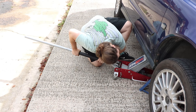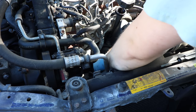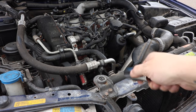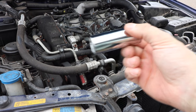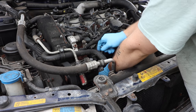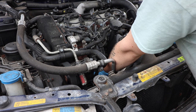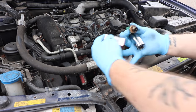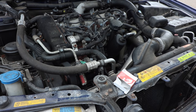I've already cracked the sump nut off and got the oil draining. As you'll see in a couple of seconds, I had to resort to interesting methods to get the oil filter out. I just had to nip out and go get a 22mm deep socket for the oil pressure sensor, because you can't really get a spanner on there because of the way it's located. So we've got this — let's get that out and then carry on. In these next couple of clips I'm just getting the oil pressure sensor out and replacing it with a new one. I'm comparing the parts to each other just to make sure they're identical — even though they should be, I've verified it. It's always good to check before you start hammering the wrong parts in.